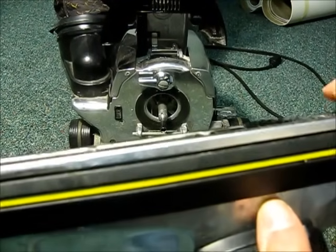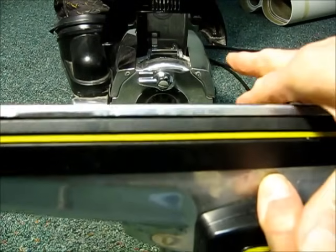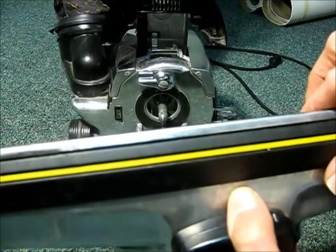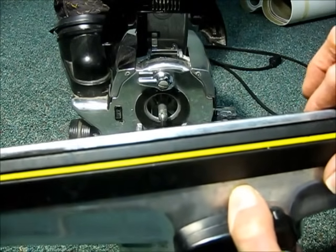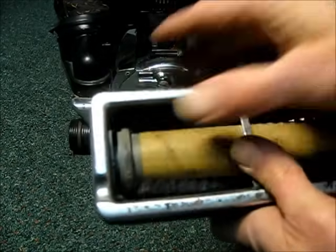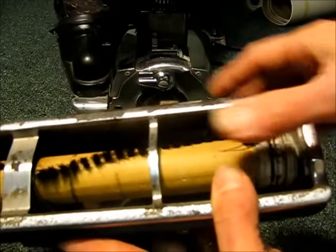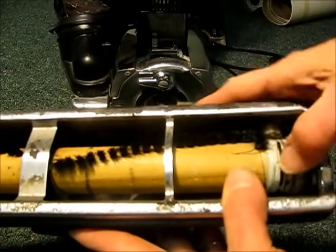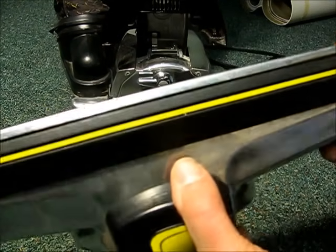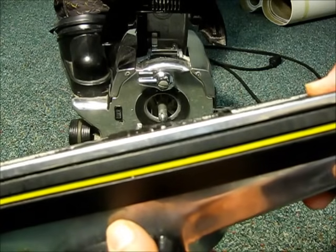Now if you look at the end of it you'll see the brushes coming up above the flush surface that rides along the floor. I've got them up just a few millimeters above — it's in position two. The twos are on either side of the middle of the roller, and the roller part is flush with the floor. So as they wear, you can move them into the next position and therefore continue to use the same brush for quite some time, which is a clever little arrangement.